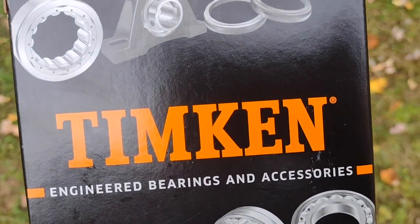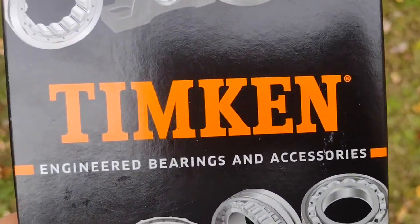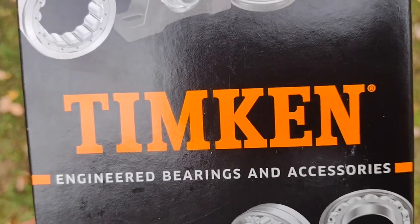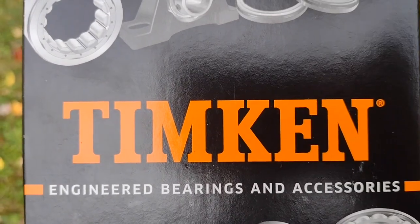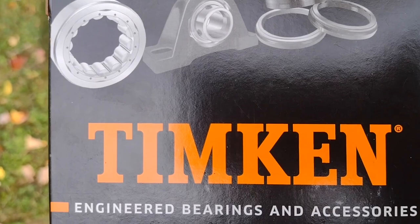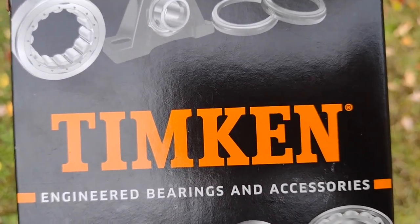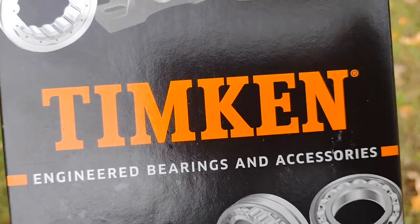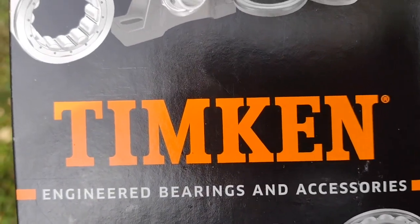Now, this is not a sponsored video, but let me tell you, the cheapest part of this entire project of what I actually had to go buy were these wheel seals. I was talking to Mechanic Steve about this, and repacking the wheel bearings on two-wheel drive trucks and two-wheel drive truck-based vans has to be some of the most neglected maintenance procedures that are out there.